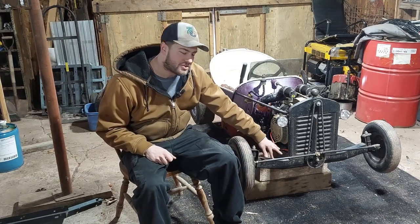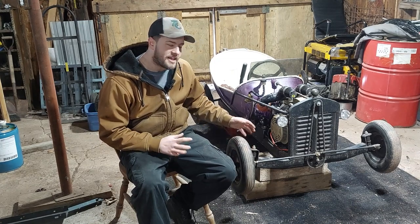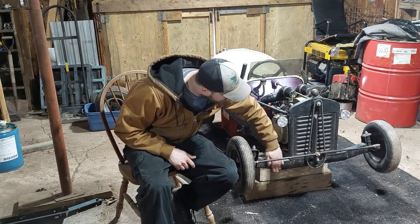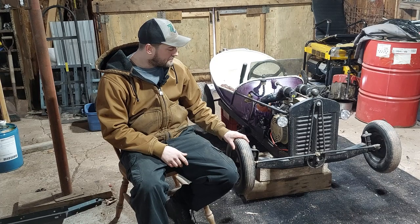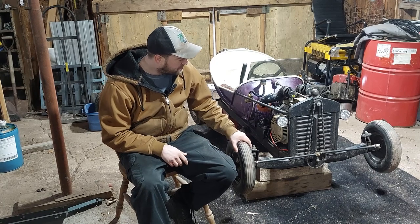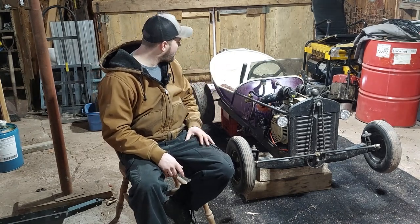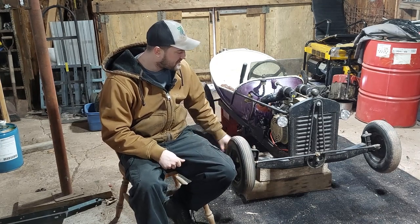And the front, I was thinking about doing the typical Springer T-bucket front end, but I like how light this thing is. And I just think a single A-arm in the front, using the old truss here as my front pivot and then a little trailing arm in back, I really think that would work great. I'm not too sure what I'm going to do in the back. I got to put some more idler pulleys in just to clear the tub on the bottom. But I guess I can just get started by pulling everything apart and seeing if we have some space for stuff.